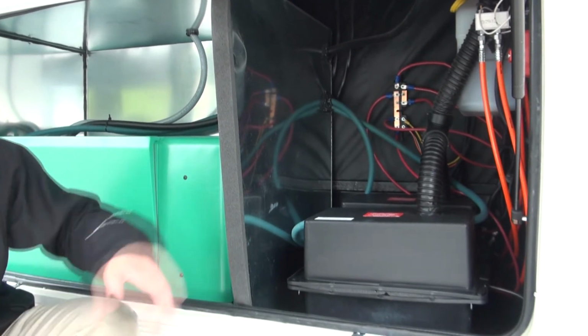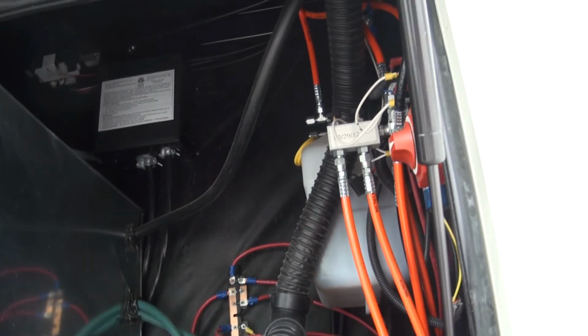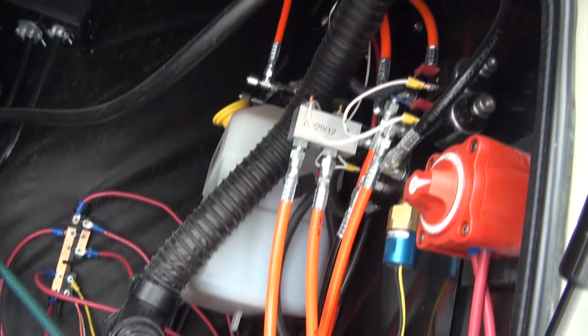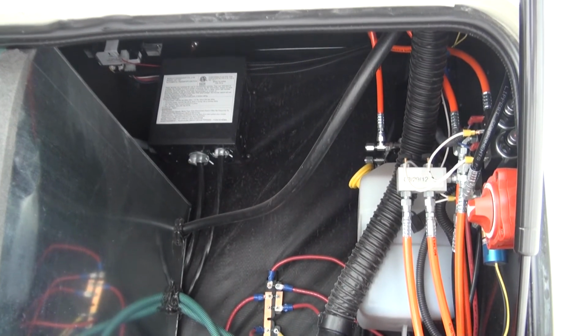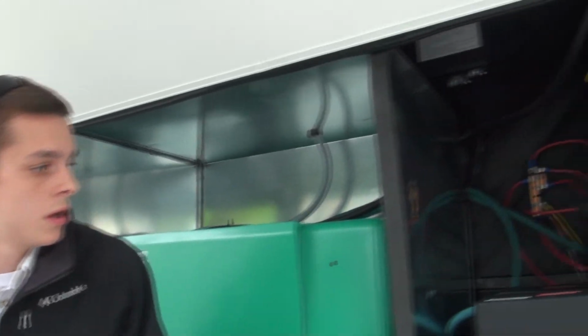Okay. And of course, up here we have the hydraulic system for your jacks, and I believe you might also have one of the slide outs on hydraulics, and I'll double check on the brochure as well. Hydraulic fluid reservoir. Okay, and you'll notice that it's halfway down. That's because everything's extended. So whatever's using the hydraulics, it's in the lines. So whenever you come out here and you've got slides out and jacks down and you're seeing that, don't fill it up. Because that will fill up as you close everything back up and bring your jacks up. So you check the fill once you're hooked up and everything's up. Right. Exactly. Okay. And once you do start getting low, any good RV dealership should have some of that hydraulic fluid. It's going to be either an LCI or HWH. Okay. Yeah. Okay, what else do we have?